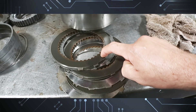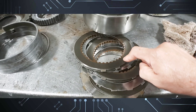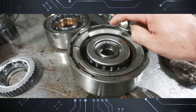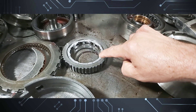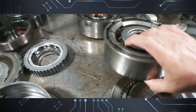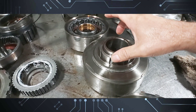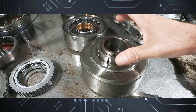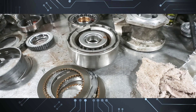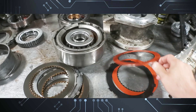There's nothing wrong with running 4L80 frictions on this 400 transmission — that's perfectly fine. We've got the 4L80 high-energy frictions for the intermediate. This is a five-clutch drum, which is a good drum, but it has a roller-type sprag one-way clutch and it needs to be upgraded to a sprag type. The sprag should also be updated from the regular elements to a 36-element sprag to make it heavy duty.